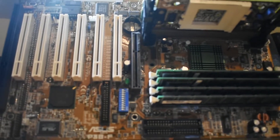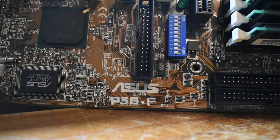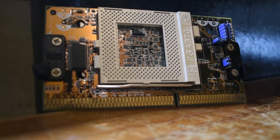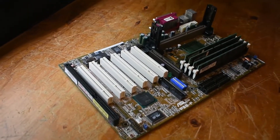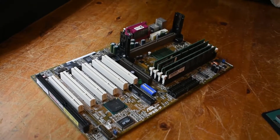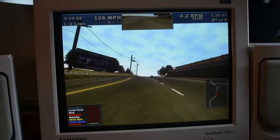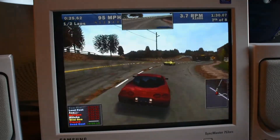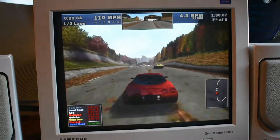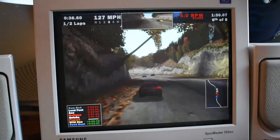Another really good budget option is to get a 440BX motherboard — a Slot 1 one — and then use something like a Slocket. You do need a good Slot 1 motherboard like an ASUS P3 B-F shown here. With a Slocket you are most of the time limited to a 100MHz frontside bus, so you just need to find a slower Pentium 3 CPU. You can actually go to a 133MHz frontside bus CPU, but you need a motherboard that has good overclocking support, and just bear in mind you are putting stress on the BX chipset so the reliability of this is unknown. This is a good solution if you only want a 100MHz frontside bus Pentium 3 — I've used Slockets in dozens of systems and they've worked flawlessly. Overall this is a great solution, but you need to be wary of what chipset is in the Slot 1 motherboard and what Slocket you use. Ideally get a Slocket with a lot of jumpers on it — they're generally the better ones.